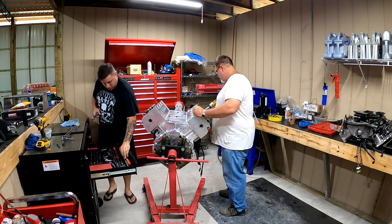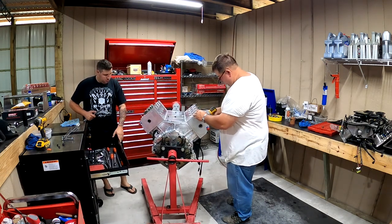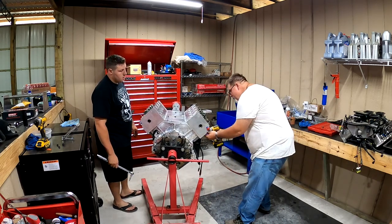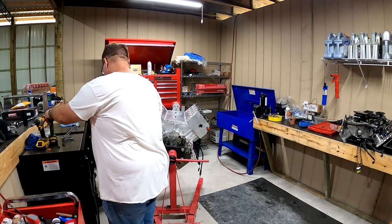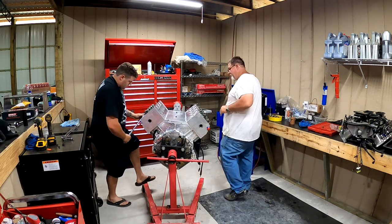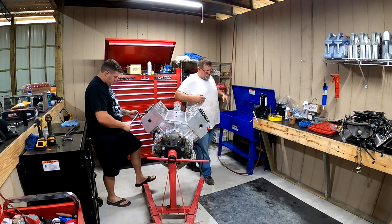That's too long. Push it up against that exhaust flange. I hate that. What you need to do is take a router bit. This time we're having things off, I'm going to cut me a little notch right there where that socket is, so it'll set up on there straight so you can get a regular half inch socket up on that.